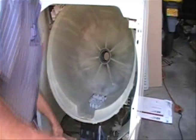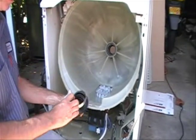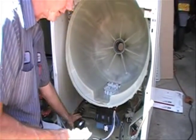The other thing I want to mention: you're going to want to pull the drain boot off so any debris that gets in there can drain. Make sure it's clean — this thing acts as a trap. Make sure nothing gets into your pump. It's a good idea to have everything clean before going back together.